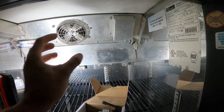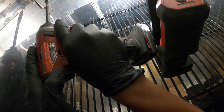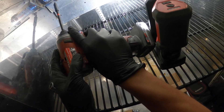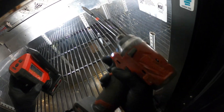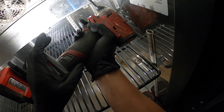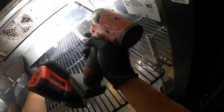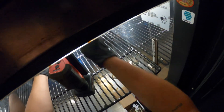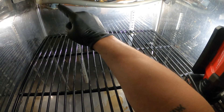The power is currently off — we just unplugged an extension cord. This does work off a solenoid valve. There's one really large rack unit, air cooled outside, and it controls probably at least 15 refrigerators, and this is one of them. Let's take off this bottle panel. We've got a drain line here and our solenoid valve.